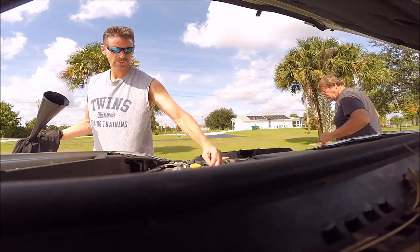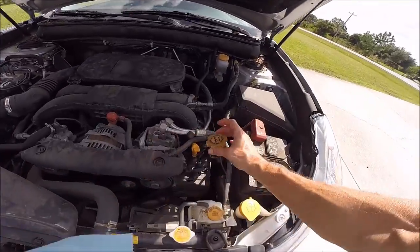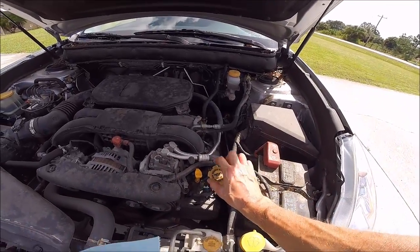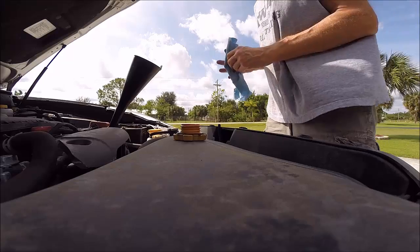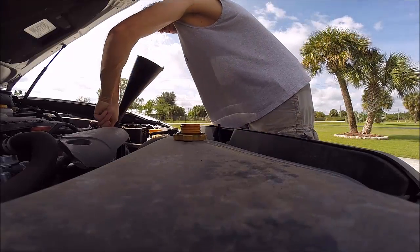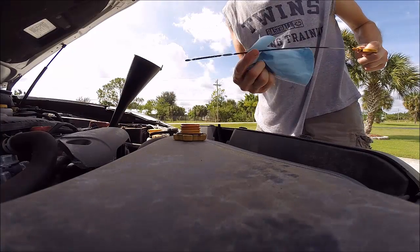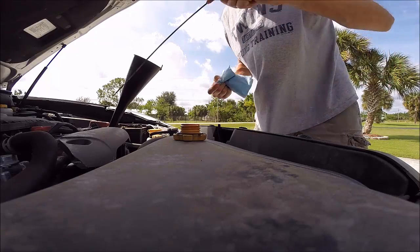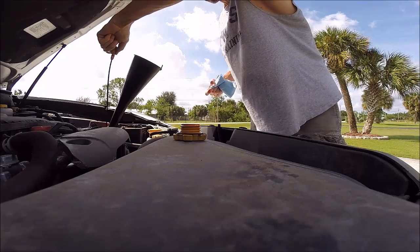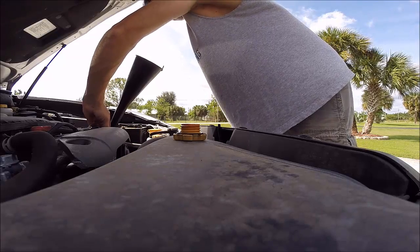Oil all over stuff. Okay, I guess I should mention where the oil fill location is. It's right here. It says on there that you need 5W30 oil, and right here is a dipstick. Very convenient. I'm just checking the fluid level now. Okay, I was pretty close with what I put in originally. Like most dipsticks, this has 2 markers: a quart low, and that's your fill. Make sure you insert it all the way to get an accurate reading.